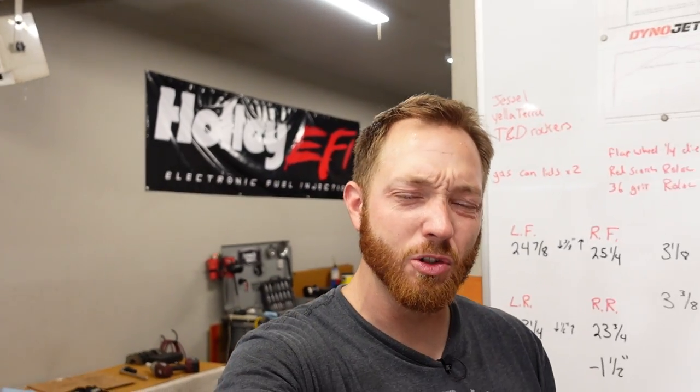They are an angled drop block just because you got to point the pinion of the differential towards the drive shaft. Right now, in terms of the setup on the truck, it's dropped about 3 inches from stock out back. And on the front, I'm still unsure of the specifics, but if I had to guess, probably 2 inches lower than stock up front, 3 out back.